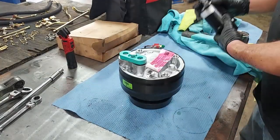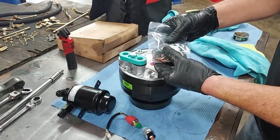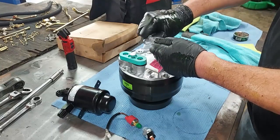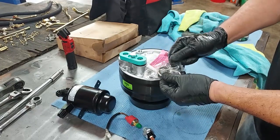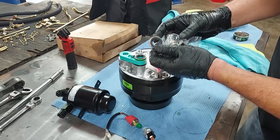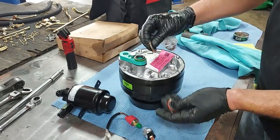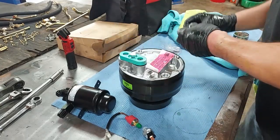Let's get our new compressor in here. Here we have our new compressor, new receiver dryer, new high-pressure and low-pressure switches, and here are the seals. With these compressors you get two different types of seals: the green one and the red one. I can't tell you how many times I see mechanics install the red one, because it's deceiving — you think you should use the red one instead of the green one. But the green one is much thicker. The matching gold one is much thinner, so people think they're supposed to use the thinner red one to go with the gold one — that's incorrect. Just throw the red ones away.